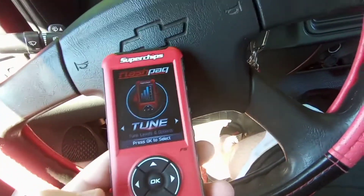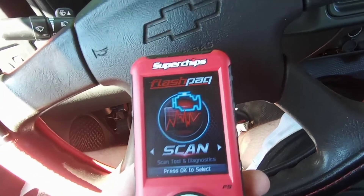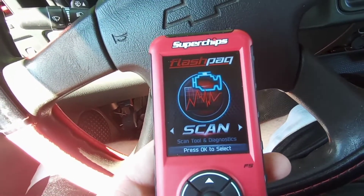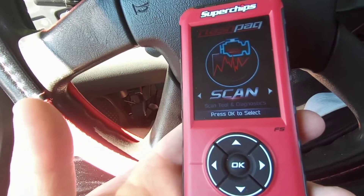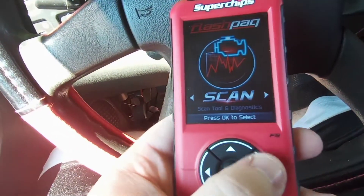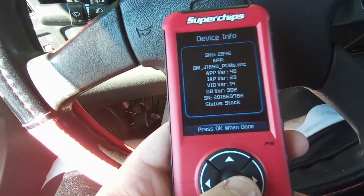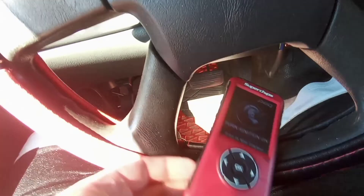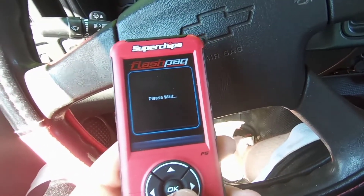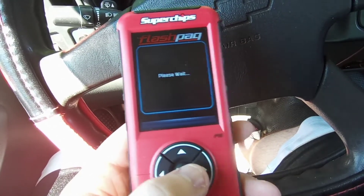Alright, so we got the tuner in. A few things about it: you can go to tune, scan as a scan tool, check engine codes, and do live data — so if you have a mildly built car you can check trim, air-fuel ratios, see if your O2 sensors are working, check knock and misfire data, and a lot more. Under info you can see device info; status is stock so it's locked on to this VIN right now. The tune I'm going to do is stock with options — even though it's a stock tune, it still has options. When you do that tune it will lock to whichever vehicle you have it on, so when you go to sell it make sure you convert it back to completely stock.